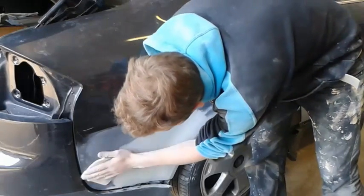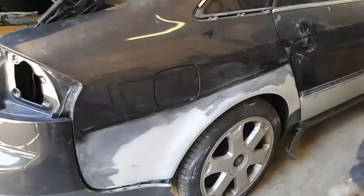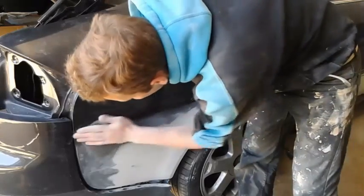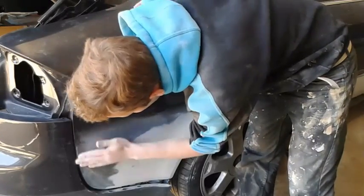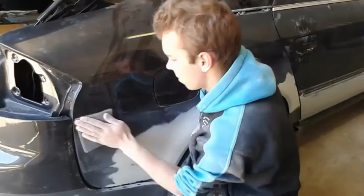After this P600 you use Scotch-Brite, which is equal to about P1000 or something like that. If you use paper, take off all the masking tape and finish the job with Scotch-Brite, and you've got a car ready for masking. There are some pictures after painting.